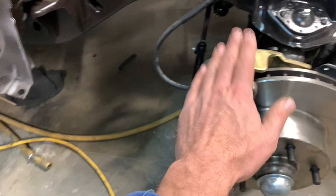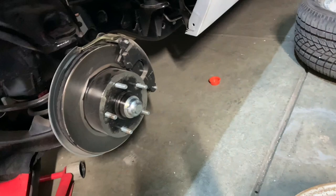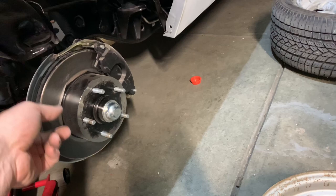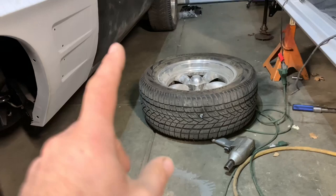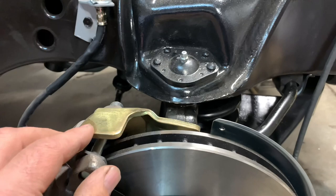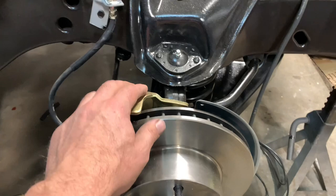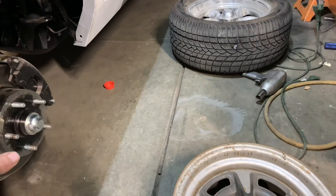I have the back-in-black bird here — my old high school car. I'm going to sacrifice those caliper brackets and swap them over to this car, because this car is going to end up having 16s, 17s, or 18s — some bigger wheels — so I don't need it to clear the 14-inch wheel. Not to mention, rear disc brake does not clear the 14-inch wheel either. So I want to swap them around. But I want to tear these apart and show the parts side by side, in case you're shopping for caliper brackets and want to see what does and doesn't work. I'm going to tear these both apart — give me a few minutes — and we'll do a side-by-side comparison so you can be a wise shopper when buying your parts.